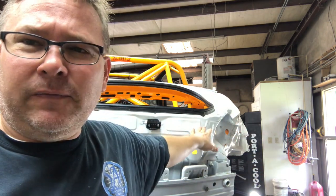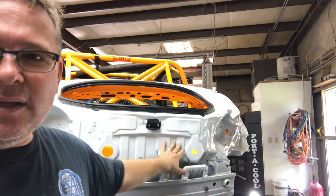You basically want to have the accident in reverse. Also, when we're pulling, there are a lot of sacrificial parts — like this rear body panel isn't awful, but when I put the floor in it's got to go away to get the floor in there. There are going to be some parts we're going to try to save, like this quarter panel is down and has a small buckle in the front, but when we're pulling it up we're going to try to finesse it so the quarter panel does not need to be replaced.